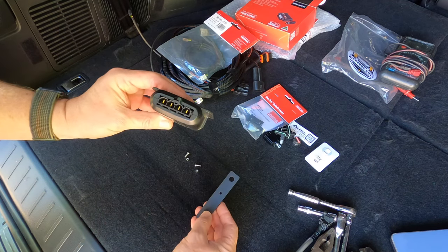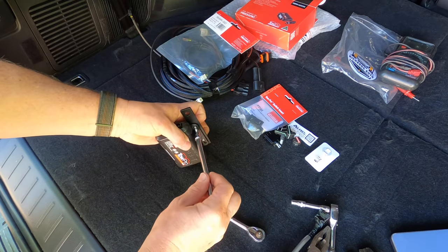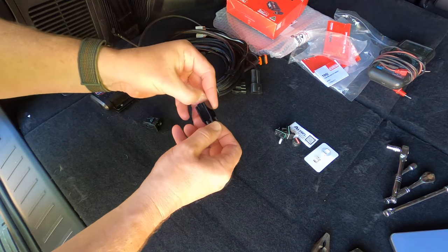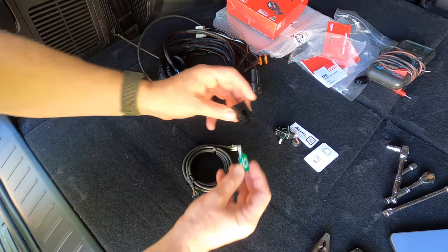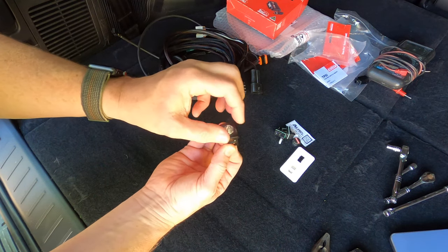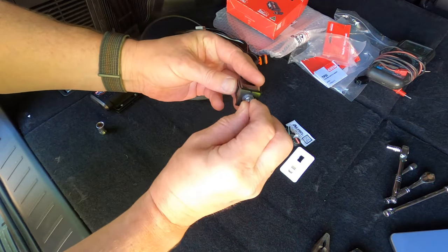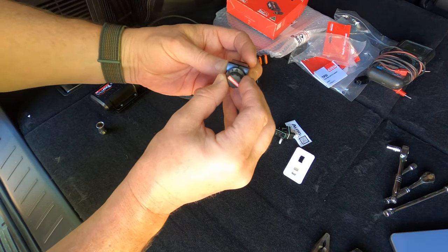Remove the battery and set it aside. Unpack the TowPro kit and find the small plastic bracket. Connect the bracket to the TowPro main unit as shown using the included nuts and bolts. Then get the switch, dash plate and the extension cable from the kit. Disassemble the switch removing it from the included black plastic casing, then insert the switch into the supplied Land Cruiser 300 switch blank. Fit the clear plastic nut onto the switch mechanism then tighten by hand with a 12mm socket — don't over tighten it. Turn the switch shaft all the way anti-clockwise, then push the red control knob on with the zero position at the top dead center.